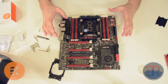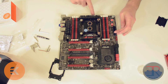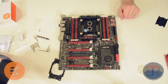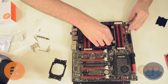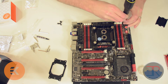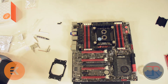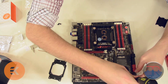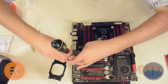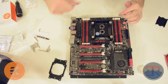There are nine screws generally on an ATX-sized board like this — all nine screws go into the motherboard tray. You're not going to do them super tight initially; just put them in quite loosely. That way, if you have any alignment problems, you won't put any stress on anything. I usually do the outer corners first to make sure every corner is aligned — if the corners are aligned, the middle is aligned. Once all nine screws are in, go ahead and tighten them all down.